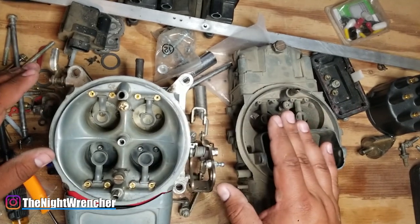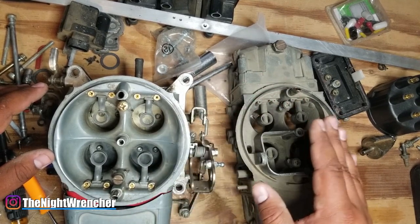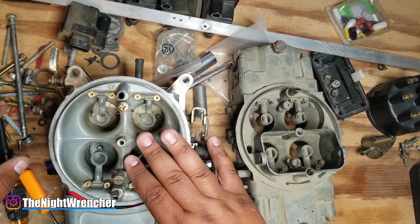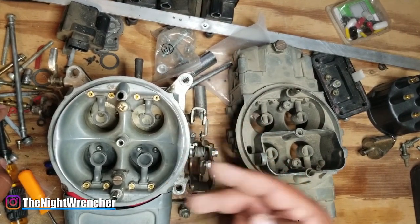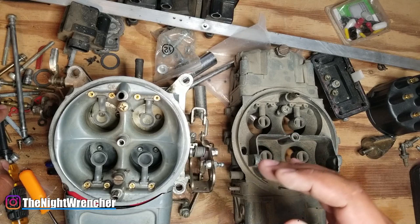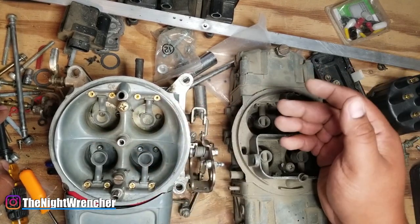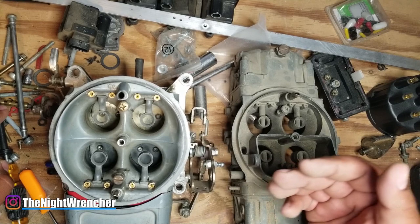If we're talking about air-fuel ratio, you want to keep it as close to 14.5:1 as possible without going so lean that you start damaging your engine. Race cars, however, want to get closer to about 12.5:1, even 11.5:1 at wide open throttle, because that's what makes the most power and it's safer for the engine to run more fuel at higher RPM. On a street application, you'll set up each circuit individually, staying as close to 14.5:1 as possible and only going down to the low 13s or high 12s when stomping on it, then going right back to that lean spot.